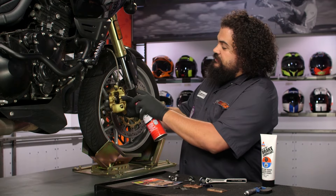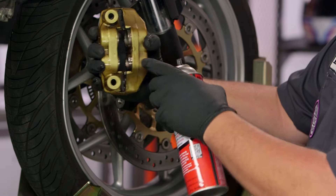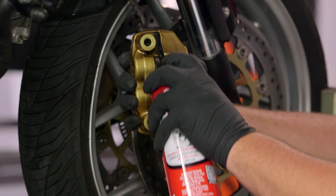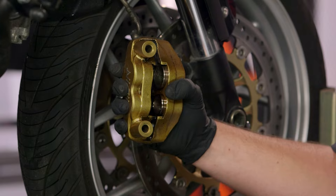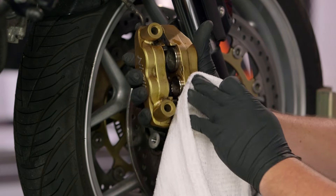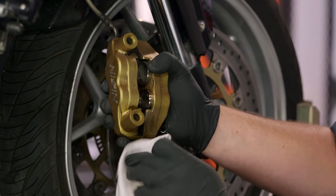So what I'm going to do here is spray things down — I'm going to spray the caliper down. Again, be careful with this stuff, it's also not really that good for you, so put your gloves on and use your respirator if you have one. One of the areas I want to pay special attention to are actually the caliper pistons here. These are sealed really only with very delicate rubber seals, so it's important to get in here and get everything clean because that brake dust on there can actually be kind of acidic and abrasive as well. I'm going to grab a rag here to help make sure I've gotten all the dirt and goop out of all the nooks and crannies on the caliper. By cleaning things up, you should be exposing a better view of the condition of the parts you're actually working on.